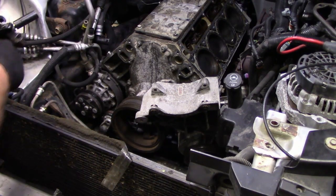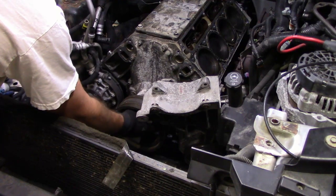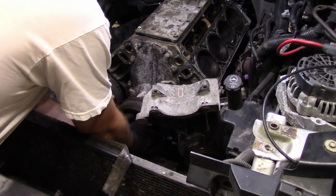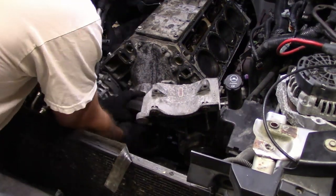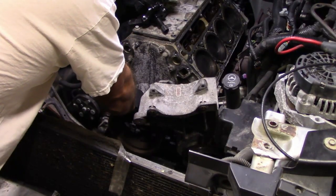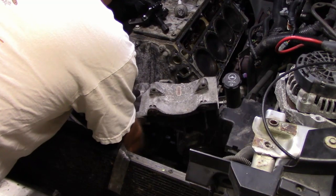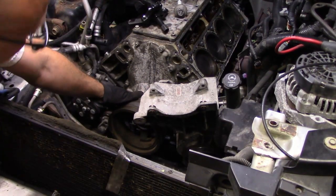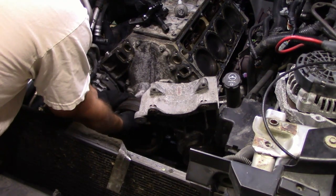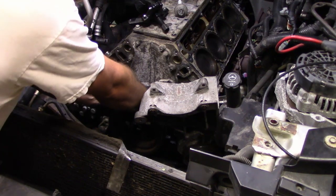All right, I have to reposition the nut, or I should say the bolt. So right now I'm using the bolt to push on since the bolt is getting replaced. Huh, now I see why this guy said to trim the edges of the bolt down. You need something to push on. I don't want to do that because I need to reuse that bolt to actually reseat this pulley.